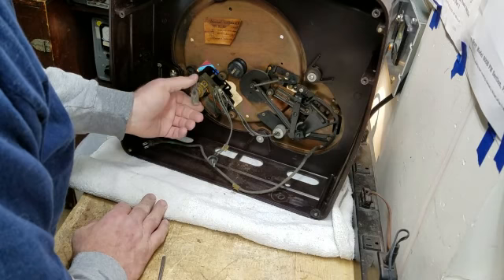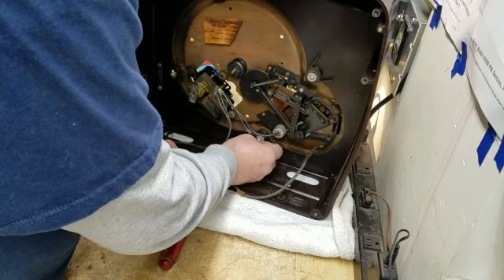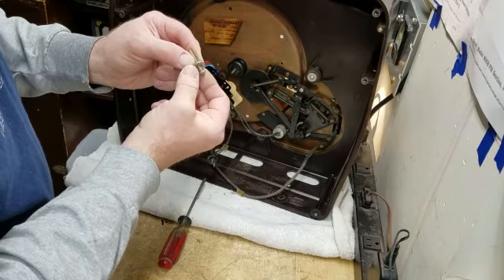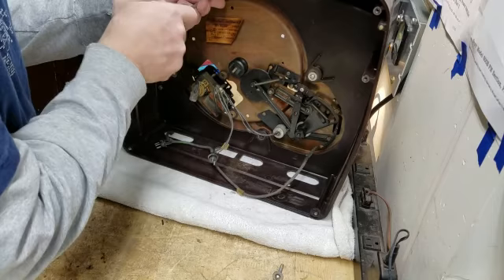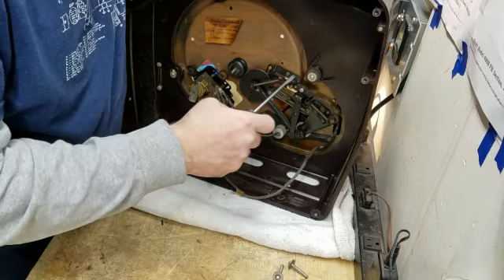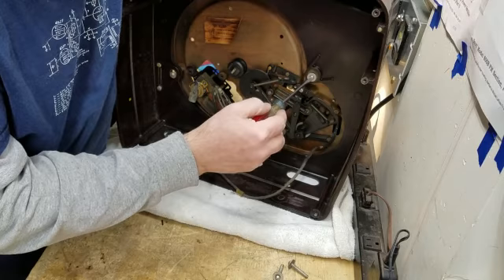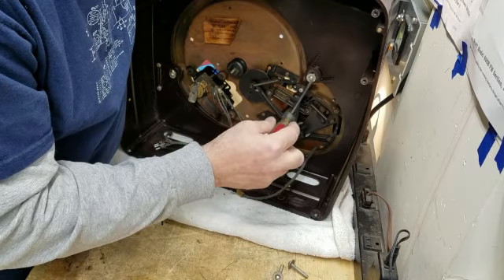If you remember right, this motor was spinning when I tried to test this. Go ahead and remove these three screws that hold the record player on. There's a long screw with a pretty thick fender washer on it — there are three of those. Then that record player should just lift right out, and I'll have to find a creative way to support the thing while I'm working on it. These 78-only record players are a lot simpler than the multi-speed record players for obvious reasons, so they're nicer to work on.